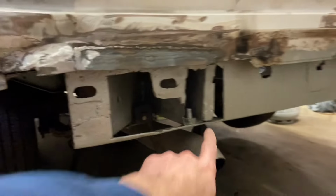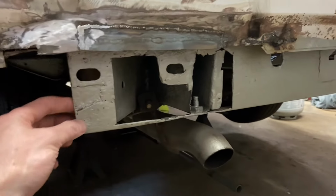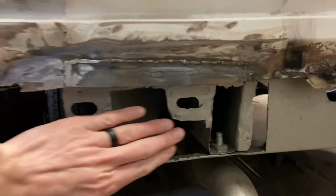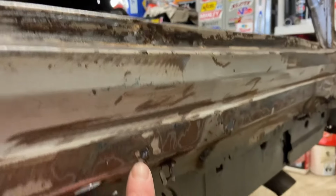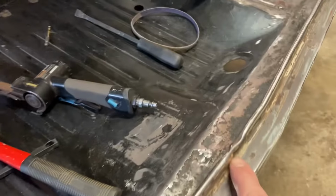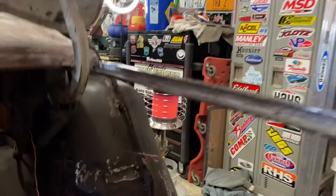Eventually we've got to patch in this rectangle that's missing out of this back bumper panel area. And then there's a structural piece that goes like this that needs to go on top of it, which is a plate that gives strength to the bumper where it connects there too. So we've got to fix that. A couple little holes, some little things around here that are just kind of shoddy and missing, and pieces like that. And then we can finally go here and tackle this wheel well.